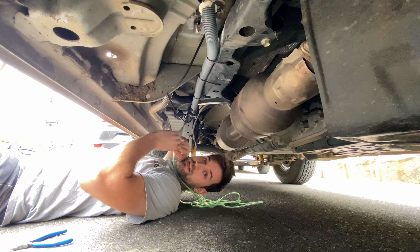That's my diesel pump and I've run it over to the back here. These two lines — as far as I can tell, one connects to the engine and one connects to the tank as the return line for the diesel. My plan is to cut this and tee into it, then use that as my feed for the diesel heater. My assumption is it'll just draw diesel from whichever side goes to the tank. The return line isn't pressurized, so none of this has to be pressurized — hopefully I'm right, we'll see.